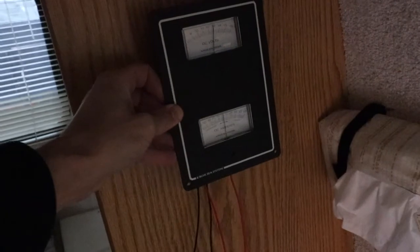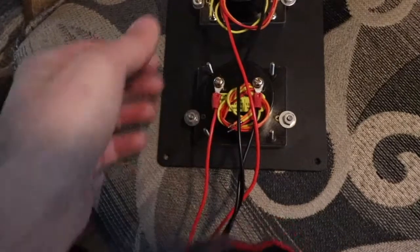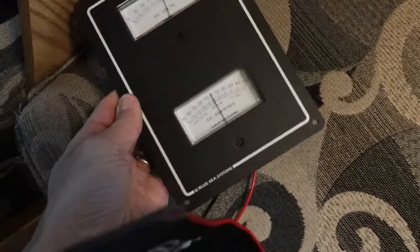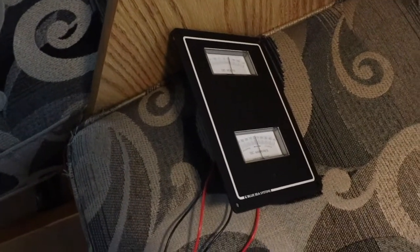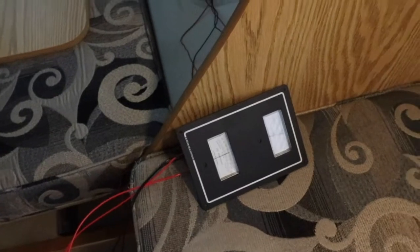This has internal lights that you can wire up, but I'm not going to do those because I've got this light right here — you'll be able to see pretty easily if I just turn that on. They do have internal lights here that you just wire to these wires, and it's kind of nice because you can do 24 volts or 12 volts. Overall, this Blue Sea stuff is pretty nice — it's for the boating industry, which I kind of like versus something specifically for the RV industry. I kind of view the RV industry as a price-driven race to the bottom, where they basically just put out the cheapest stuff they can. But for people that are boating, they kind of depend on this stuff — more of a life-or-death situation. So when I can, I get my low-voltage stuff from the marine industry.